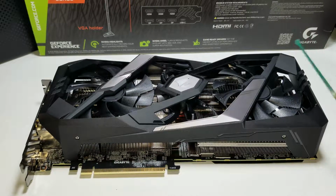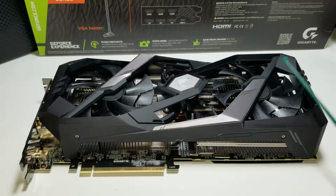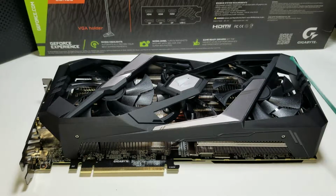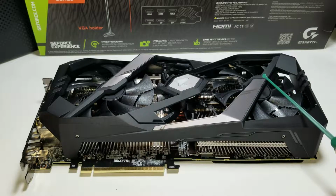So then I'm like, okay, let me go down. I don't want to go just negative 10 from that. I don't want to go right at the limit, because you never know if there's a spike in the game or something and it crashes your game. You don't want that. So I went down to plus 80, but then plus 80 is my limit with this graphics card. I mean, plus 100 is the limit, but to safely say plus 80 is the limit, to try to protect the card as much as possible. And then I go down even further, to plus 60, because in the tests I did I found it more stable at plus 60 than plus 80. Plus 100 was just borderline. And you don't want to be stopped when you're playing, right?